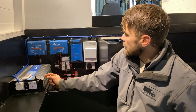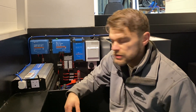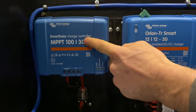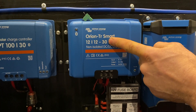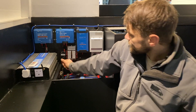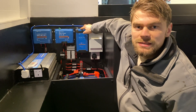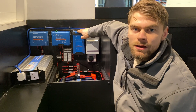Looking to the top of the electrics board, we have three Victron Energy chargers — these are the three chargers we use in our off-grid conversions. An MPPT rated at 30 amps, designed to carry the charge from the solar panels on the roof into the battery bank. A DC-to-DC smart charger, also rated at 30 amps, which connects the leisure battery bank to the vehicle alternator once the engine is running. The final charger is the Blue Smart charger, again rated at 30 amps, which is the mains 240 volt charger — active when you're plugged into an electric hookup point to charge the battery bank via mains electricity.